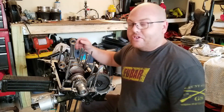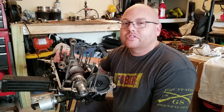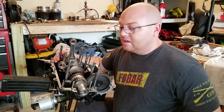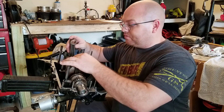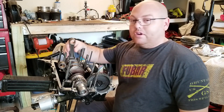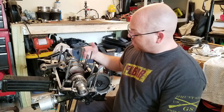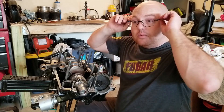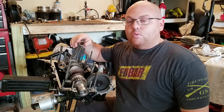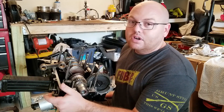This is really all I have for you guys today for tech tips. It's something that can easily be messed up if you don't know — there aren't a lot of clear videos out there on YouTube. I hope this one is helpful when it comes to setting up your engine for correct timing on number one cylinder. The key things to look for: make sure your number one rod is fully extended, your woodruff key is pointing down, and when looking at your camshaft the lobes for number one and number three valves are pointing down — that tells you you're in the compression stroke for number one. You want your rotor on your distributor to be in the firing position for number one so that everything is perfect.